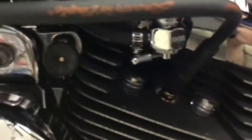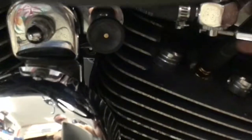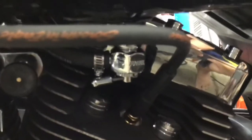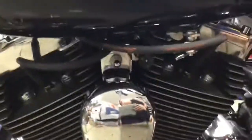Remember, when you put the petcock on, the on position needs to be forward. This is kind of weird — I'm not sure exactly how this changes my tank reserve. I believe off is forward, on is in the middle, and reserve is toward the back. I tested the fuel flow and the middle position got the most flow, while the back got less — so I'm assuming that's the reserve. For you guys coming from fuel injection like me, remember to turn that petcock on. I've started it and ridden it and had it die on me once or twice because I forgot to turn it on. Thanks for watching the video.